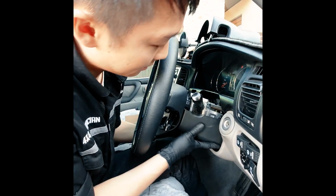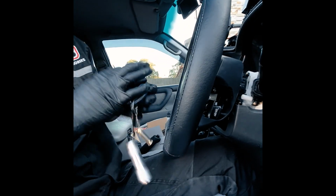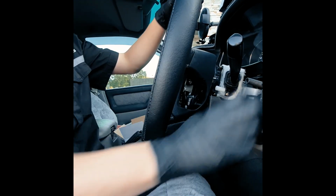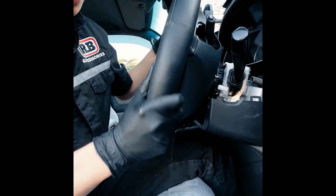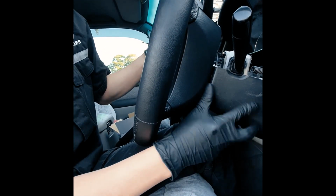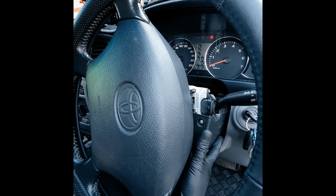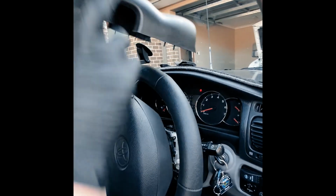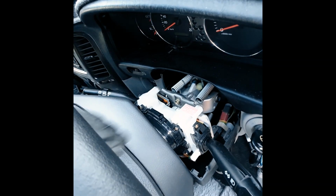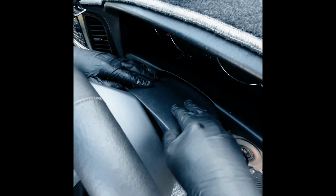And to put these back on, because you notice that the bolt holes are covered now. The steering lock's engaged right now. Turn off the steering lock and just turn it. And actually, you won't be able to get it from the bottom, but if you turn the wheel, you'll be able to get the screw from just over there. So we'll put the two sides together. There's a peg that goes in that corresponding hole right there. So make sure that's where it's supposed to be before you push it down.